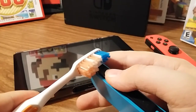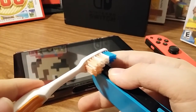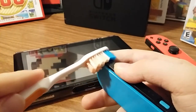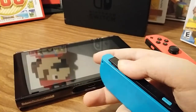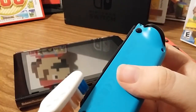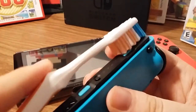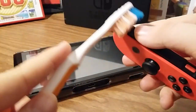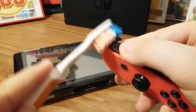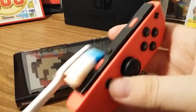Then you're going to want to push it inward, and then pull up like that. That'll get some dust that's really stuck in there. Then brush it some more, and that should solve your problem. Sometimes I'll get dust in the rail here, in the crack of the rail - so you can just take the toothbrush and rub it across the rail. That will get all the dust out. Then you just do it to the other Joy-Con to make sure they're both in tip-top shape. Brush it, pull up like this, then slide it across to get all the dust out.